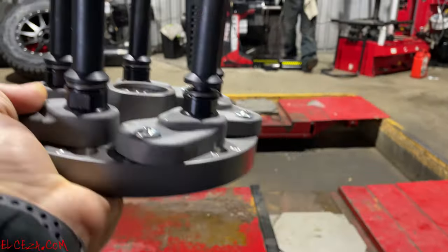At that point, what we're going to do is a centering check. You hit centering check. It's going to tell you to rotate the rim around to the valve stem at 12 o'clock. Drop the hood, hit start, it would spin up. Our initial road force balancers would spin up, raise the hood, tell you to loosen the butterfly, reach in and grab the collet with your hand. So I would back the butterfly off until I could get my hand down in here, grab the collet with my fingers, grab the tire, and either rotate the collet 90 degrees and the tire 90 degrees. Personally, I went, why not just rotate the tire 180? Same effect. Rotate the tire 180 degrees, crank it back down, rotate the valve stem back to 12 o'clock, fill it where it is, drop the hood, it spins up, and then this rim would come up and face you, and it would either be red or green.